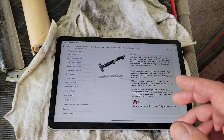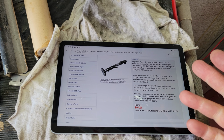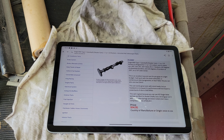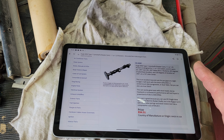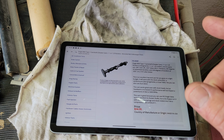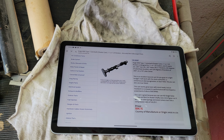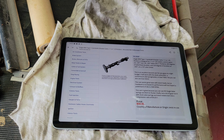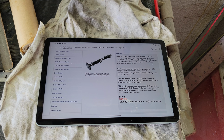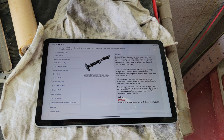But it will have that point where if you're flooring it all the time, it can get hot. Like if you're going up big long hills, it can get hot. But I've got an engine that's at 9-to-1, and it's amazing. Other than on a long hill, I just can't stay in it. I have to let off the gas. And then once I crest, I have dual coolers. I have a doghouse fan shroud and a second cooler, and the oil just cools the engine down along with all that air from the doghouse and the big fan. It cools it down pretty quickly, and also the super cool tin, which works, by the way. And it cools it down quick enough right away, and I'm able to jump on it again after I crested the hill. About 5 minutes of being easy on it, and I can get back into it.